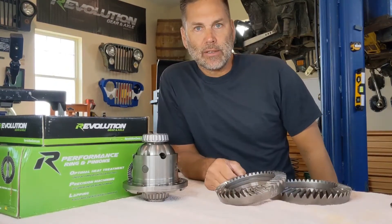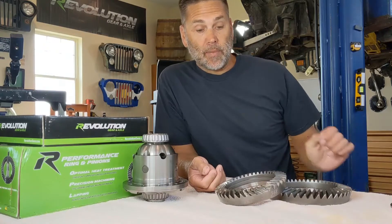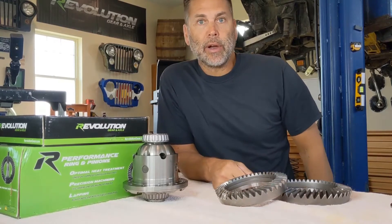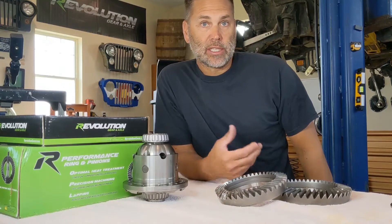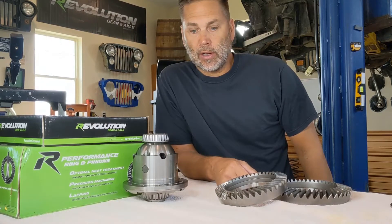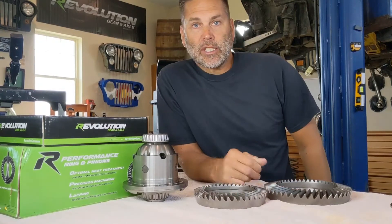My application is all I need — I'm running 35-inch tires. The Dana 30 on the front side is strong. I'm leaning toward my ring gear breaking because my rear ARB wasn't working, I wasn't locking up, and I was putting a lot of stress on the front axle to do the majority of the work. I didn't really have a choice — I'm in the middle of a trail when this happens. Things are bound to break; it's just part of Jeep life.